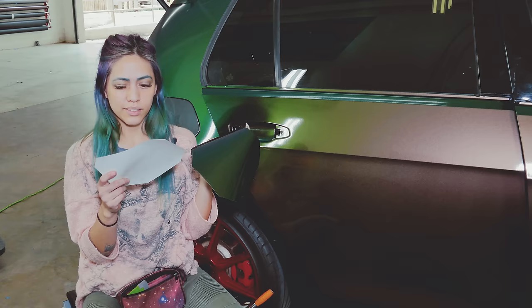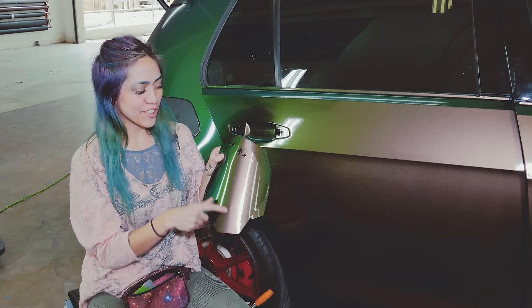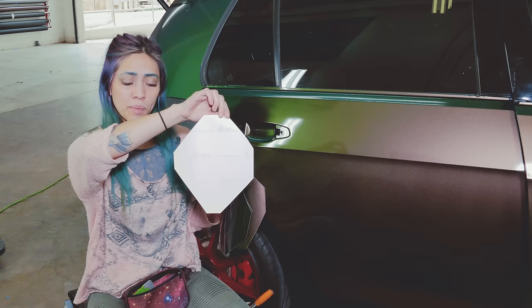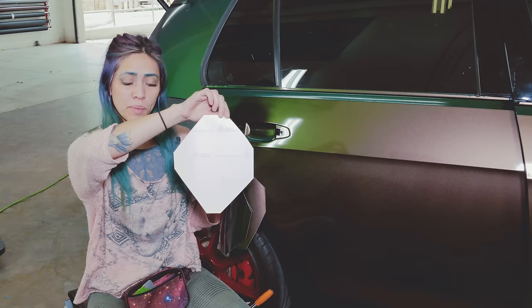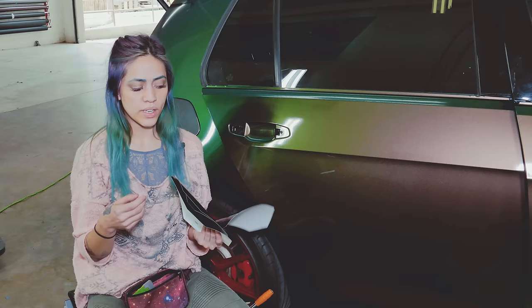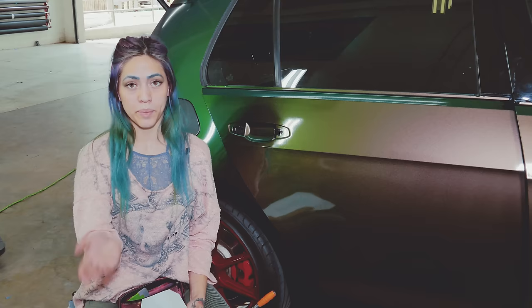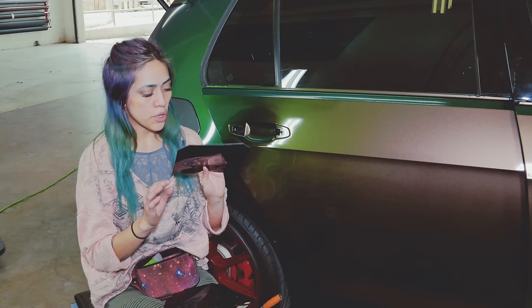I made these horribly miscut octagons — I think they're octagons, there's eight sides. So what I did is I actually put an up arrow for whichever way is facing up. With Avery, their newer stuff has print on the back of their lining, so it makes it really easy to know which direction is up. But when I'm cutting all my panels beforehand I always, just out of habit, mark this on the back of the film and put an up arrow so I know what direction I need to install that vinyl. I actually do this with all of my films — better safe than sorry — because you might get a film that you don't think is directional and it ends up being directional, and you screwed yourself over because you had a panel turned.